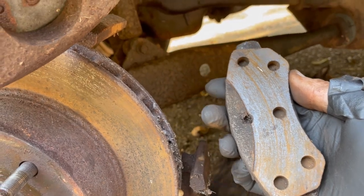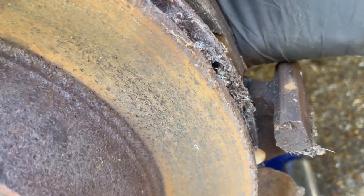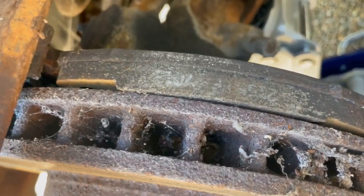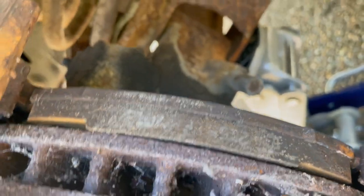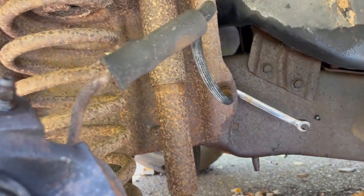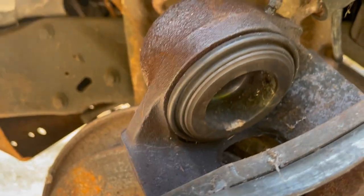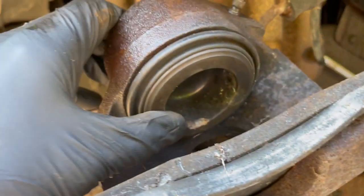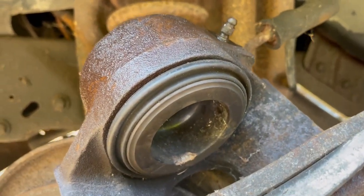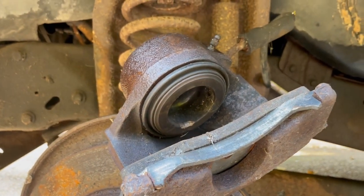This pad is shot - I can't reuse it. It's supposed to go in like this, and you can see that ridge is making the brake unusable, so the whole pad needs to be changed. I've got new brake hoses for it, though they're being a hassle to get out without snapping things off. I've got the bleeder loose, so when you compress it fluid ought to squirt out - but it's not, so I think the caliper may need changing too. Off to the store for brake pads and a caliper.